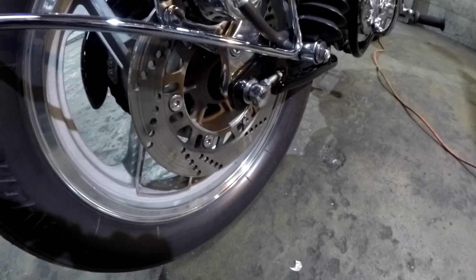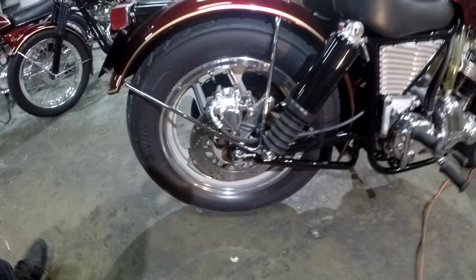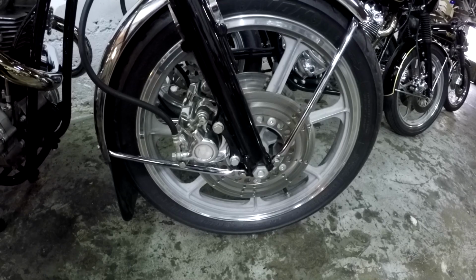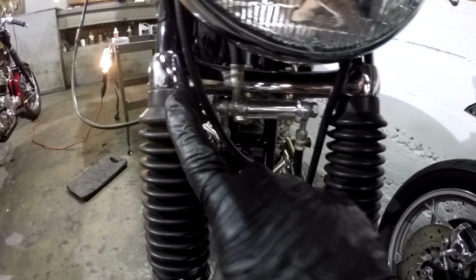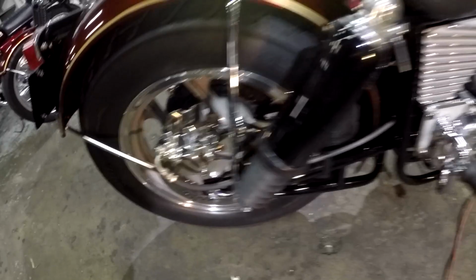These are the most difficult to do. I would suggest don't do Ninja wheels. The KZ, I think, looked the best with the straight spokes. These were a snap. No spacers, no machining. They're exactly the same as a Norton. The center to center on the yoke. Don't quote me, check your measurements. But I advise, don't do the Ninja.